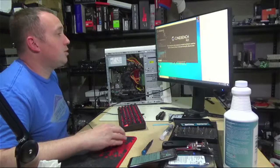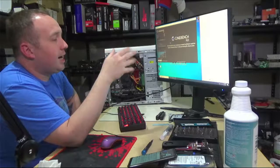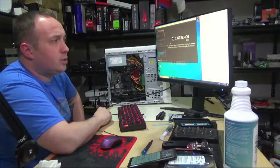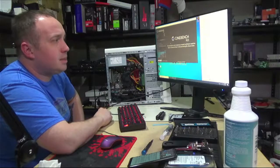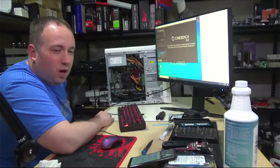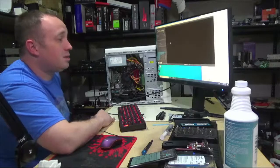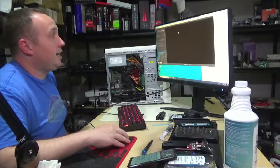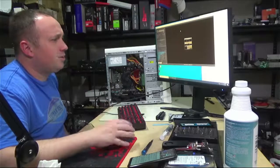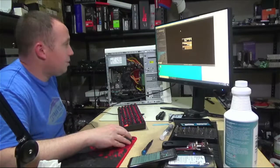So let's start the multi-core workload. So the last time, on the first run, it got a maximum core temp of 78C, which I felt was a little too high for a quad core that shouldn't be pulling more than 80 watts. And that's 80 watts during turbo. Once the turbo expires, it goes down to like 65. And maybe it just is this crap cooler. Maybe it just needs a better cooler.